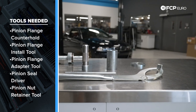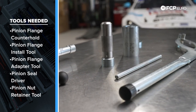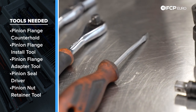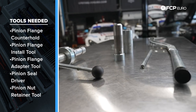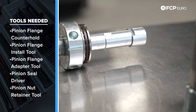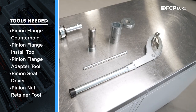For this DIY, we used a series of special tools from BMW to install the pinion seal. The biggest one — before you ever remove the pinion nut, you want to mark it first. It's a 32mm 12-point socket to remove the pinion nut. You'll probably need a three-jaw puller to physically remove the pinion flange — sometimes they slide off, sometimes they're stuck in place, so definitely have a puller on hand. To remove the seal you can use a flathead screwdriver or pry bar. To install the seal, we'll use the special seal driver from BMW, which sets the correct depth and holds the seal so the inner spring doesn't come off. There's also a pinion flange installation tool to press it back onto the shaft, and a special driver to deform the retainer and lock the pinion nut in place.